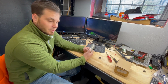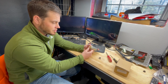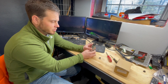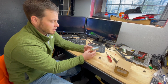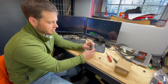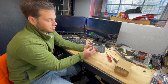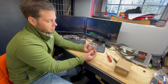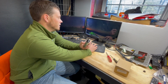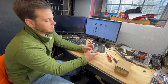Now, this was an old pump that we had just laying around the shop, and we're going to use it in the low buck Hemi truck project, just for the sake of saving money, right? So it's a pump we had laying around. Instead of buying another, we'll use it. We have two problems. One is we are missing the electrical connector that left evidently with an old project. We don't have the connector for the top, and we do not have a fuel filter sock for the inlet. I took the mesh screen out just to show the insides and how it has metal gears, but we needed those two things. So I set out on Amazon, and there are many options for the 255 liter per hour.